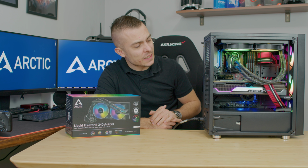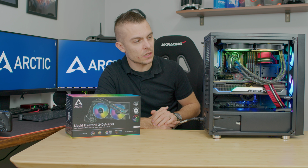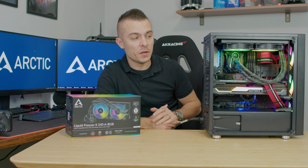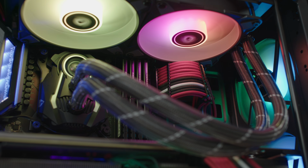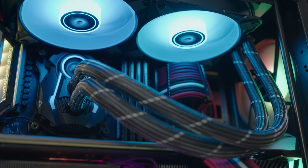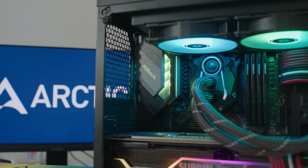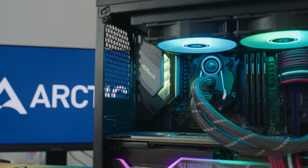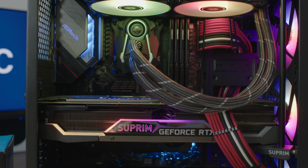So I was running the AMD Ryzen 5 5600G on 100% load, AIDA 64 Extreme Edition, for around half an hour, and I was quite surprised with the temperatures. First of all, because even some bigger air coolers got 65 Celsius degrees with 6 heat pipes. Now, here we have 59. And I can't say I'm shocked.